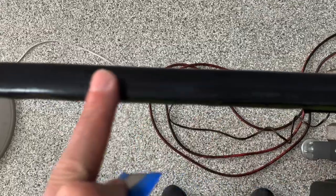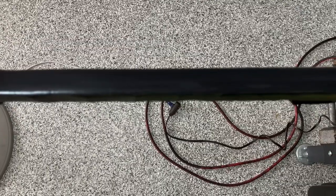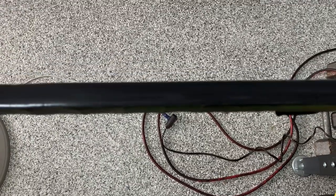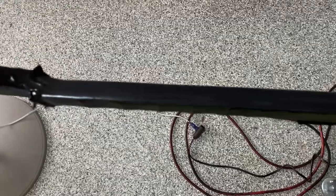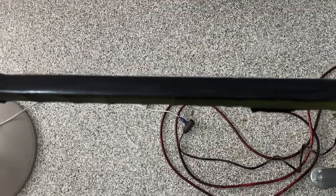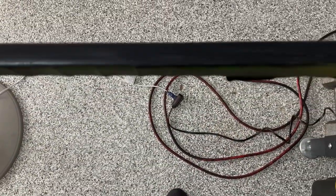What I did is I just started scraping along to get rid of the run. I've got a little bit more wet sanding to do to smooth it out. I start out with 600 grit, then to 1200, and finally 2000 grit, and that gets rid of the run. Then I will wipe it down really good with alcohol — just standard rubbing alcohol — and then I will be ready to paint it once again and get rid of the run.